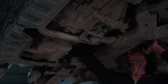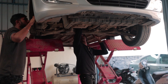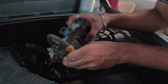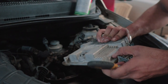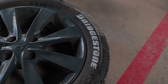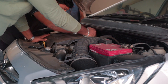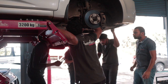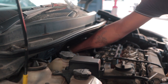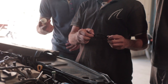Unfortunately, while we weren't in town, the Verna got a new downpipe as well as a new performance muffler, and we unfortunately couldn't film the remapping process of the Verna either. In the first video of the Verna, we took out the ECU to read and get a backup of the original file — more or less the same process is applicable for the remap. The downpipe was made by our mate Amir from IES Performance, and the issue is a tiny leak near the gasket area, which can happen since that area gets so hot. The boys disconnected the downpipe to remove the gasket and fix the leak.